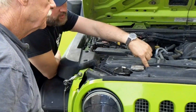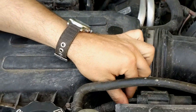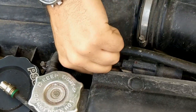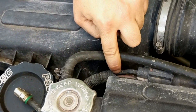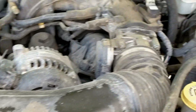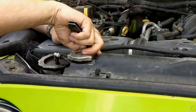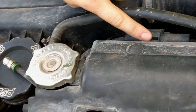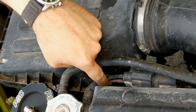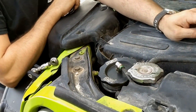This is your fan connector — this will plug into the new fan. And this wire right here is your signal wire, a real small one. You'll cut it and the signal wire will come from this side. I run it inside the grill and put a new piece of loom, come out here. The wiring attaches to this side because it's controlling the fan. This side of the wire you just cut back and disregard — you don't want the factory trying to control the fan anymore.